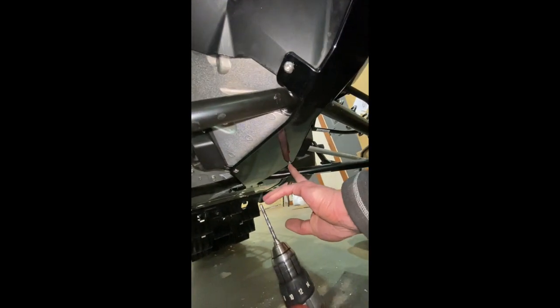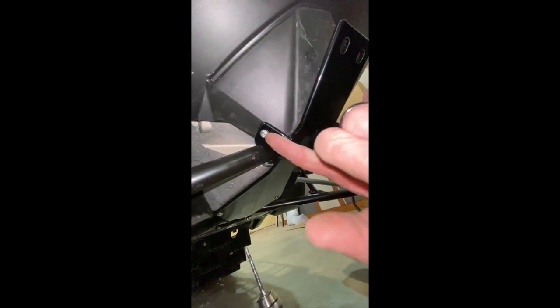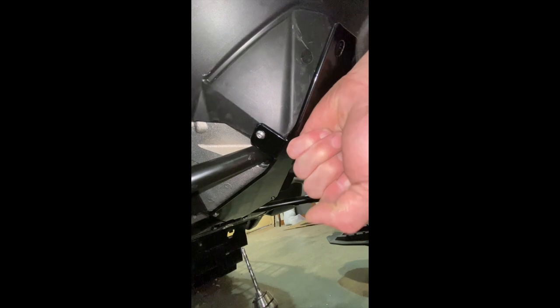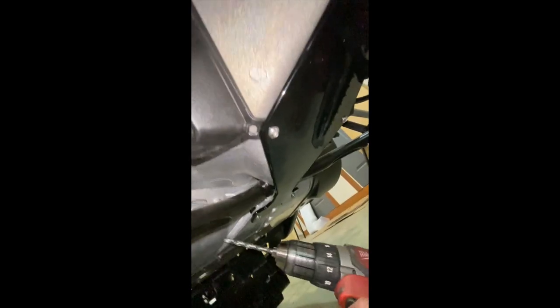All right, so with the skid plate, you can put these two bolts in, kind of loosely put them on there, come up to the front, drill these two out, push it up nice and hard, and drill these out for 1/4-inch. And then you can put these in, tighten all these four. And you come to the back and drill and bolt these. So there'll be a bit of a gap. You'll end up sucking this new skid plate onto this casting. And then the skid plate's installed. Then you're ready for the front bumper.